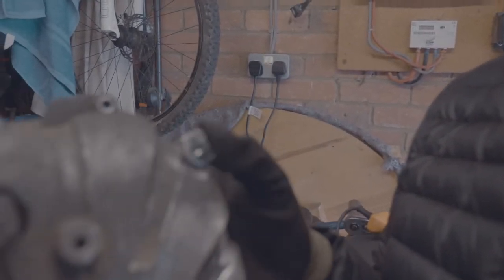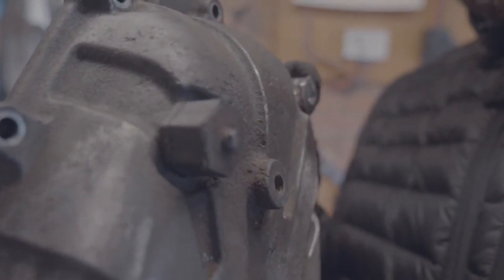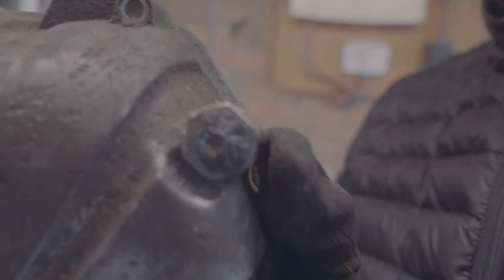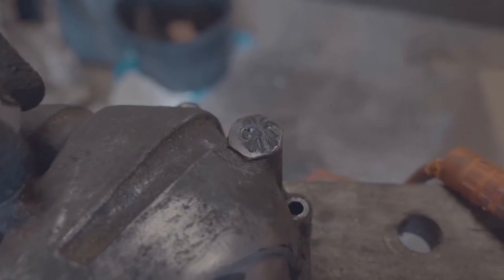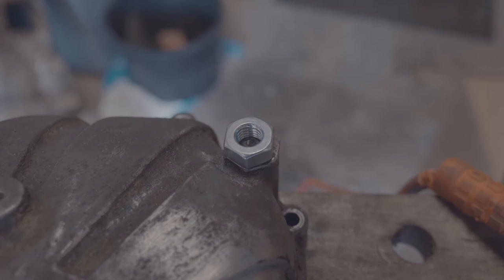The engine cases are going to shot blast and powder coat, and in order to do that I need to take off some of the bolts. I've got a bit of a problem. On the sump where it connects to the bash plate there are some bolts that hold it on - you can see them here - they're held on by rubber mounts and as you can see these have snapped. Underneath those rubber mounts it screws into the actual sump itself, but I can't take these off. They're supposed to be 20 mil however they're so thin you can't get any purchase on them. So I'm going to find a welder and get these welded to the bolt to take it off.